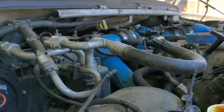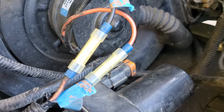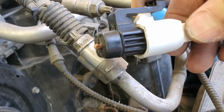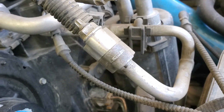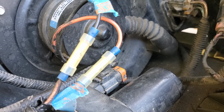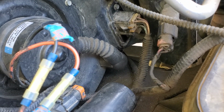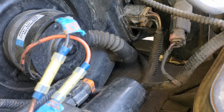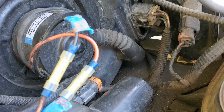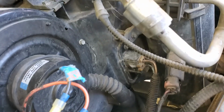So unless somehow something gets reversed in my dash, which I have no idea about, I decided, plus this thing was burnt, and it was $37 from the dealer, so I was like, you know, I'm just gonna switch them, which I just did. See if the blues are switched, and now it blows really nice. So there you go. New fan, switched wires. Solved the problem, I think, though.